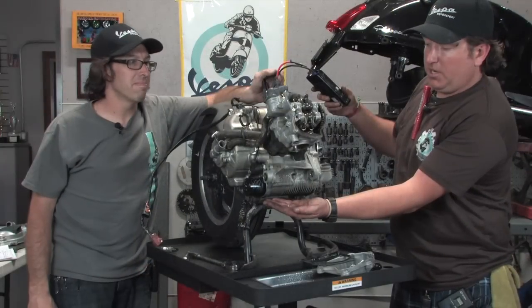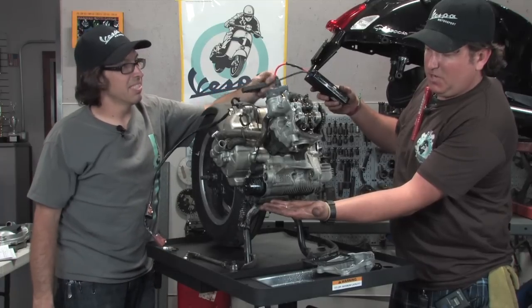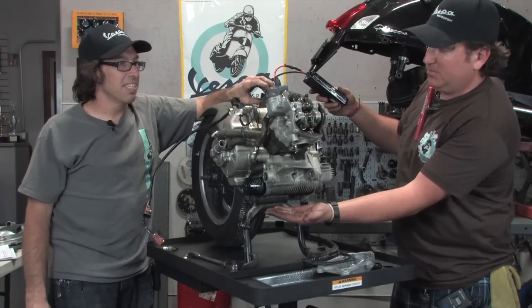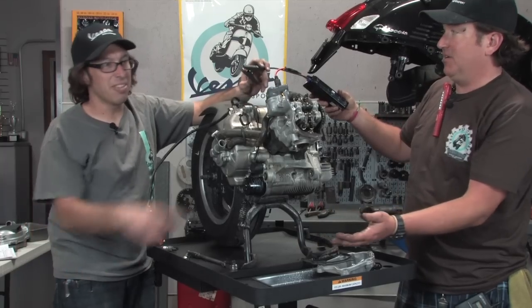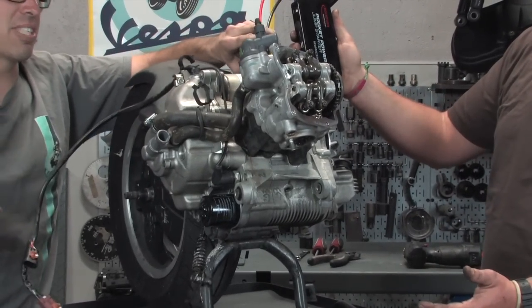So Robot's gone ahead and removed the spark plug, and as expected, here comes the waterfall. Look at it. It's just dropping water droplets, drop, drop, drop. And I'll show you how much water is actually in this engine. I have the spark plug out, everything's actually connected. If you hook 12 volts to a starter, it actually will crank over.